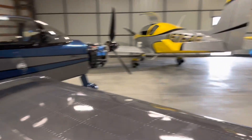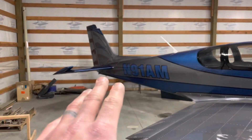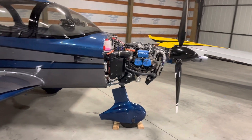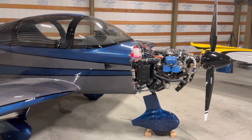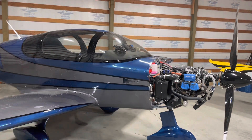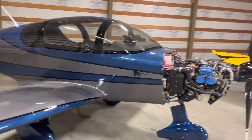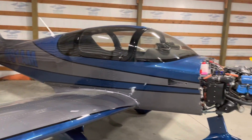Keep in mind, if you want to put four grown adults with bags in the back, removing that counterbalance weight isn't going to be enough. That's why the cowl is off here — we developed some removable counterweights, up to 50 pounds, that go up in the engine compartment to fully offset loading grown adults in the back with bags. Different solutions for different people, but we can always get it to work out.